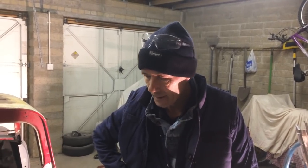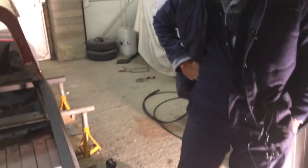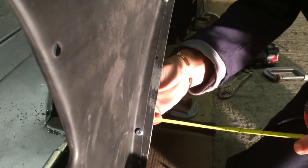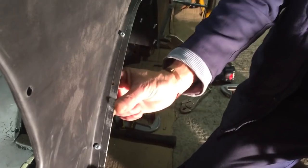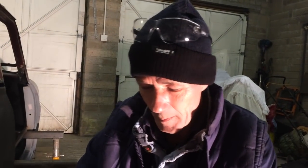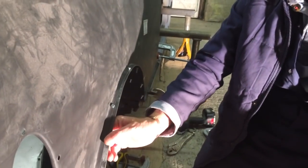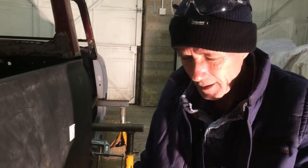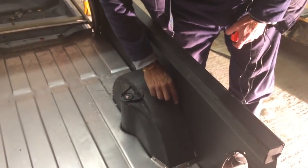And again, on this side of these tubs, this is what you've got to watch when you're buying pattern panels. If they're not heritage panels, these are Magnum panels, and I'll let you see on this side. You can see that return flange here. That is 25 mil of a flange on that, and we were leveling it up on this edge, like you would think you would do. So we lined up the wing with this edge of this flange here, but there was a big gap between this edge here. It wasn't lined up flush where I want it just now.